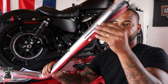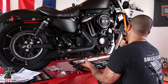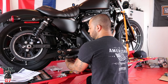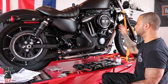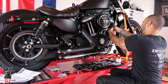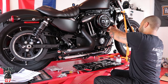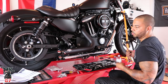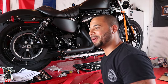We have our nut plate in the back — we slip it in and then these two screws from the back of the plate hold it in place. You don't want to tighten all this up yet so you have a little lag to play around with the top of the exhaust. Once that's in place, we push it in, put our flange on, put in the exhaust bolts, and then we can start screwing in the nuts. We're pretty much done with this — just need to connect the O2 sensors.